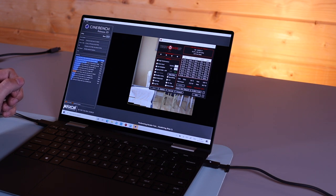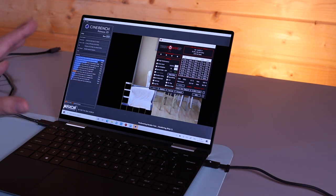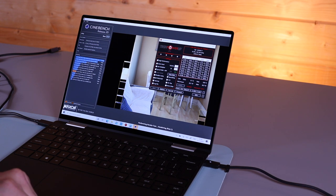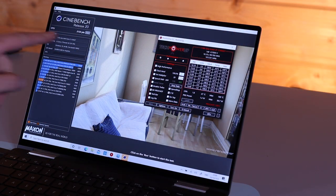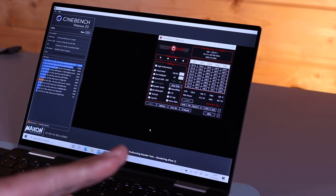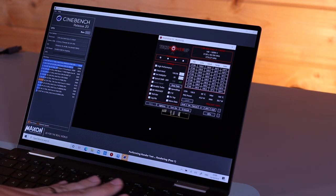This is just on the Optimized profile. I got a score of 2117 in Cinebench R20 — that's quite a bit higher than the 9310, and that really surprised me. From what everyone had told me before, the 2-in-1 was supposed to run at less wattage than the 9310. So I'm not really sure what's going on here. I'm going to try the different profiles. On the second run, we're still getting 28 watts and 3.2 GHz on this CPU. Third run finished at 2123. On the XPS 9310, by the third run, it was starting to throttle down from 25 watts to about 22 watts — so let's see if this one keeps up or starts throttling.